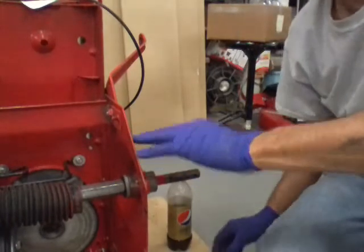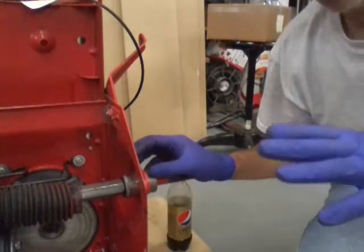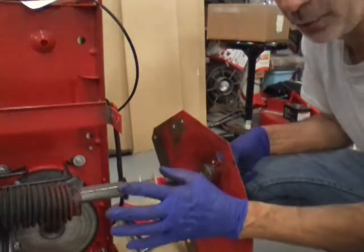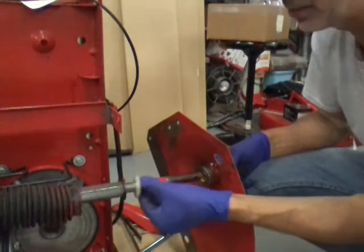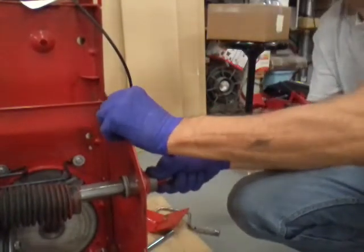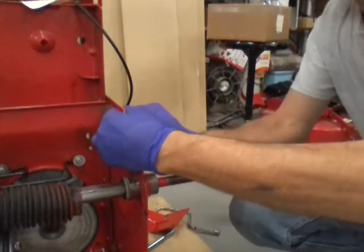So let me take this fender off and put the tie rod in, add my other shim, and put it back together. We just got the fender off. We're going to add one more shim — that makes three. Get that thrust washer inside the hex shaft where it belongs and we'll put the fender back on and put all the bolts back in.